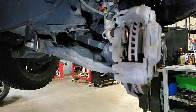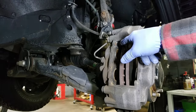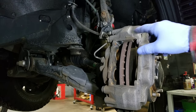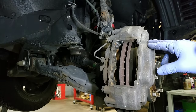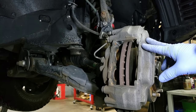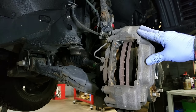I've got bottles of brake cleaner — go ahead and give that a wash out. Put a drip pan on the floor. I went ahead and got this all wire brushed and cleaned off nicely. One thing to note as well: if you are going to be wire brushing it, it's probably best to wear a dust mask. They don't have asbestos like they used to, but it's still not good to breathe in any of that dust.